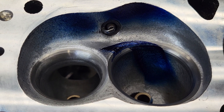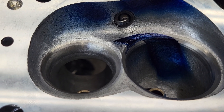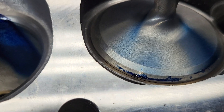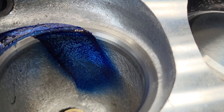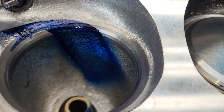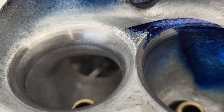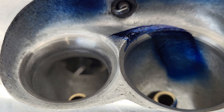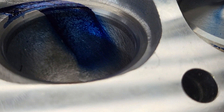This is a low-buck project, so I'm trying to keep the angles on the existing valve whatever they are — keeping the existing five-angle on the intake. I radiused out a few angles on the bottom of the exhaust and the exhaust picked up nicely, but it's still not perfect in every way.